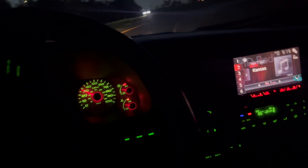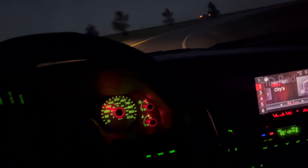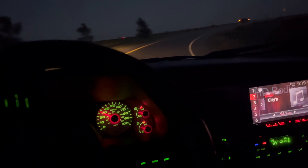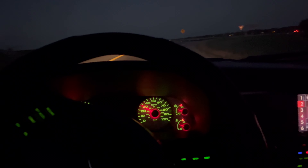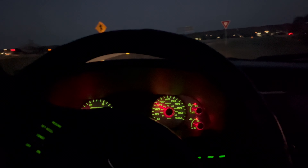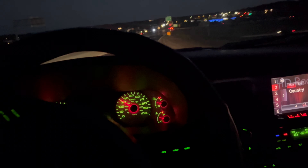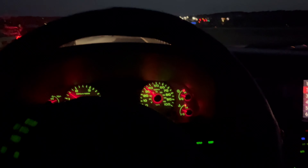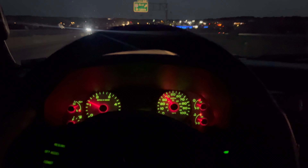These tires are shot from riding with the geometry they've had — I can feel them driving straight, they've got a little washboard going on, like the belts are starting to turn. These Michelin A/T2s are great until they get old. I put 170,000 miles on one set before — not a joke. Then I blew one out but it still had tread; they will blow before they wear all the tread out.